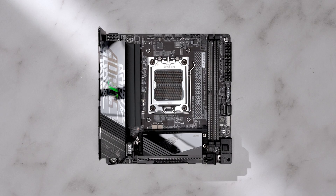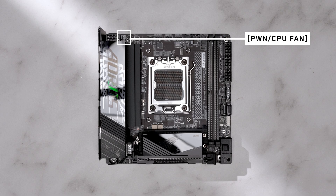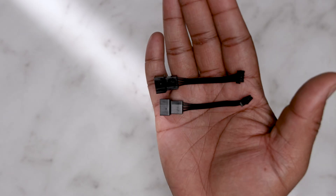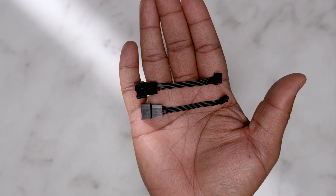For board connectivity, you have your 8-pin CPU connector. Next to it is one of three fan headers — this one is a normal size one for the CPU fan. There's one RGB LED header, two RGB Gen 2 addressable headers, and two smaller fan headers for additional fans. These smaller connectors require an additional adapter, which introduces a new point of failure.